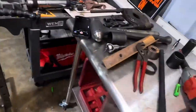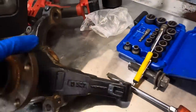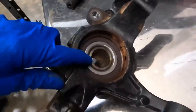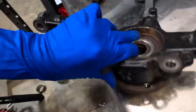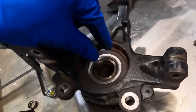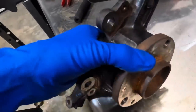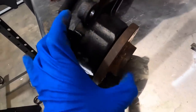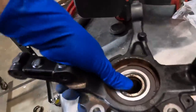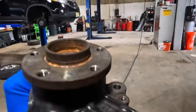Let's see what we've got. Does it spin? Yes it does — look at that, she turns. This operation is a success. One quick thing: the mechanism that prevents this from coming apart while driving is actually going to be the axle that splines through there. The axle is going to contact this inner race of the bearing and contact the outer hub. As you tighten down that axle nut, it applies pressure to that bearing race, locking the thing in position. So once it's all assembled, it's a permanent situation. This project is complete — I'm going to run it next door and deliver this spindle.